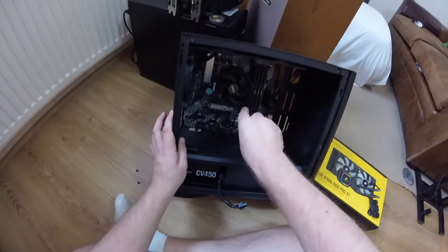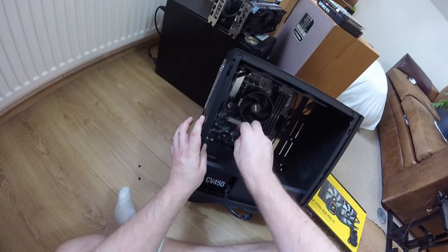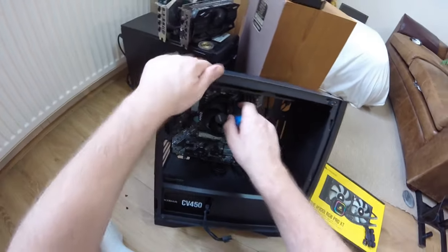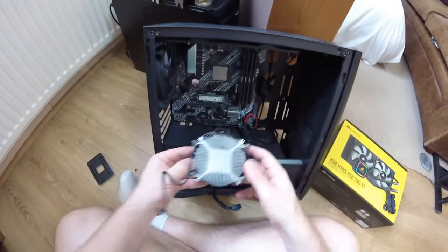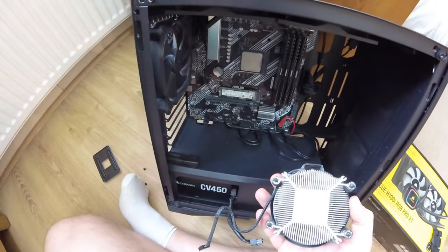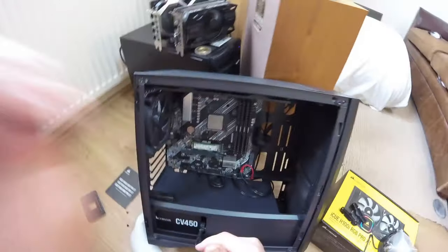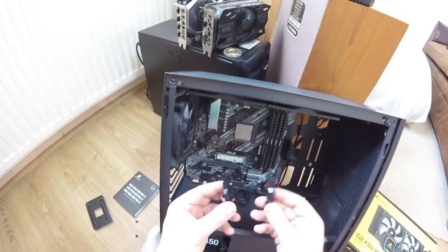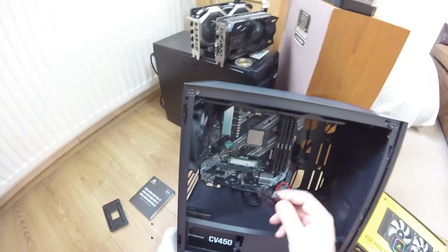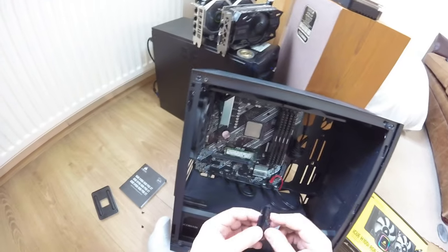The problem I had is that I assumed the thermal paste would be dry anyway, but I knew this came pre-applied so I didn't actually end up buying any. Unfortunately it was very much dried out because this computer has stayed on pretty much constantly since I've had it - it's been either mining or gaming pretty much non-stop. So the thermal paste was completely dried out when I took it off. This is stuff I've reapplied - some cheap stuff I got - it seems to have done the job. Now I'm going to clean this off and clean the processor, clean this old radiator, and then fit these brackets. Now these brackets should have come with the motherboard - I was really annoyed. I got this from Scan Computers and annoyingly these should have come with it. They're part of my motherboard, but for whatever reason they didn't supply them to me, so I've had to go out and buy these separately, which is kind of annoying.